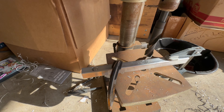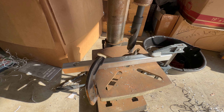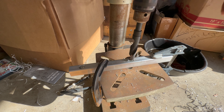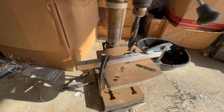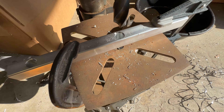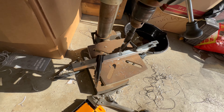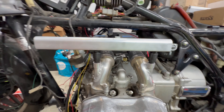I already drilled this hole — since it's the same as that one, we're going to chamfer it with a three-quarter this time and see how that does. It's still chattery. Oh well, it'll do — it's a chamfer, I just need to lube up the o-ring when I get in there. But the rest of the passage is nice and smooth at least on this one.